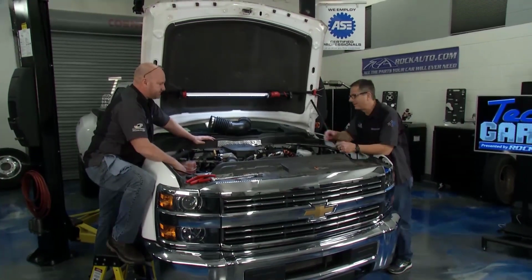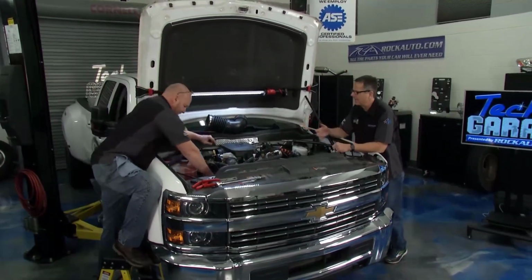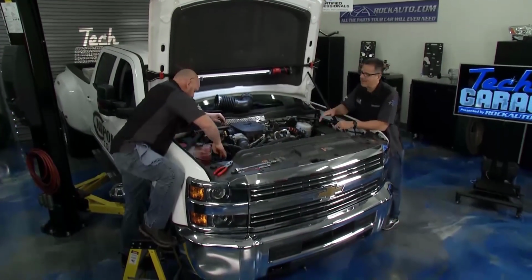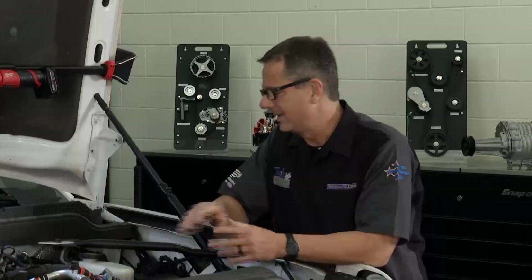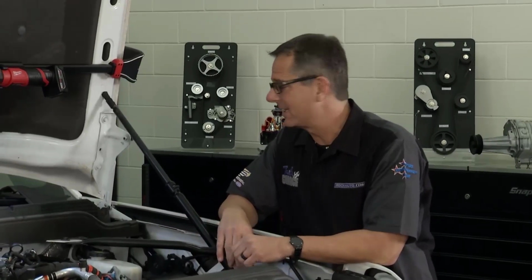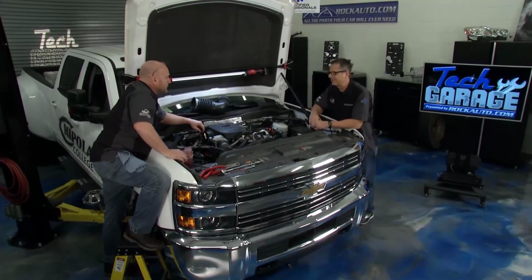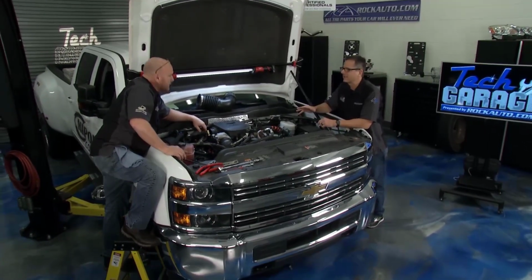Exactly what's going on. Well, you know, this is a work truck, of course. You go out in the morning, it doesn't want to start, sometimes hugely extended starts. I come out, I pump, pump, pump, it's ready to go. Next day, pump, pump, pump, it's ready to go. Well, I'm tired of getting out and doing that or going over meeting the guys to do it. So a common problem with these Duramax is definitely that water separator sucking air.